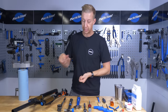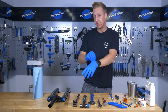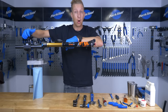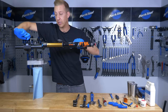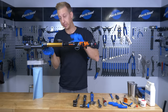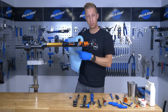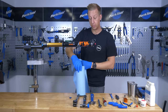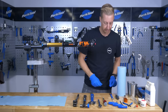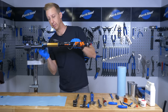Now let's get involved — we'll fast track this and show you how to take that air leg out. Rubber gloves on. The fork is off the bike, which makes things much easier. I'm also using a work stand, which is really useful for working on suspension forks — you can clamp them securely without risking damage. First, make sure there's no air in the positive chamber, which is the one you inflate on top of the fork. Make sure you lay all components down on shop towel on your worktop so when you reassemble you know the correct order.